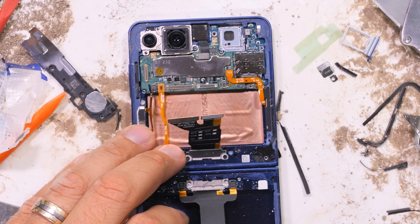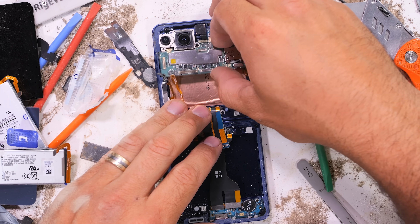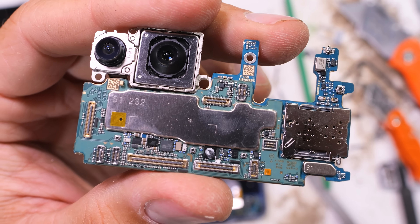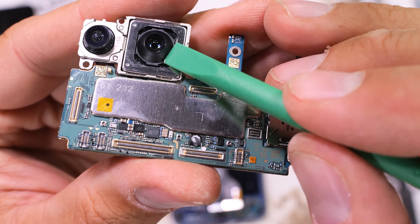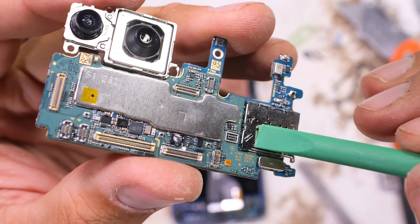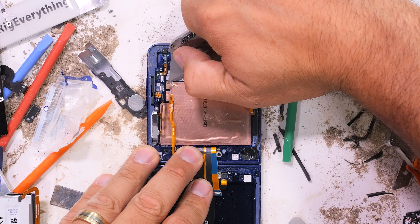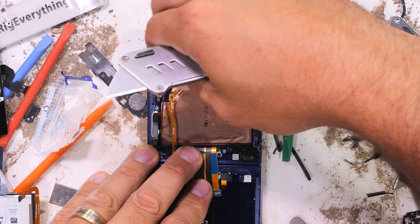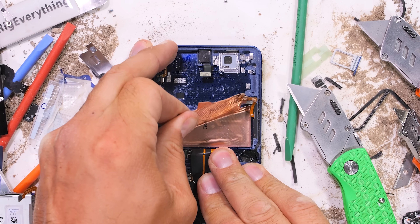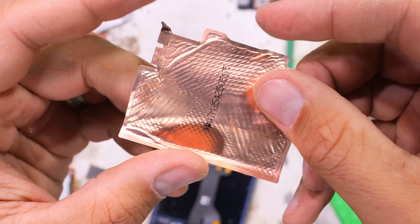There's a large copper vapor chamber revealed sitting under the battery and motherboard. Now that the battery is gone, we can pull up on the motherboard, clearing it from the Flip 7 frame. You can see that it's a double-stacked unit by the green motherboard on top and the blue motherboard on the bottom. The main 50-megapixel camera does have OIS, while the 12-megapixel ultrawide does not. There's also no thermal foam or thermal paste bridging the gap between the motherboard and the copper vapor chamber — it would cost next to nothing to implement and only improve thermal performance. But maybe we'll find some in the Fold 7 when we take that apart.